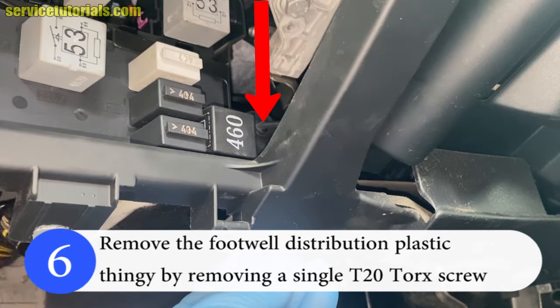You need another person to help you connect the pipes from the car to those from the heater core. One pushes the pipes from the outside and the other one from the inside. If it's difficult for you to connect those four pipes together, then you can grease them with some Vaseline at the ends where the gaskets are.